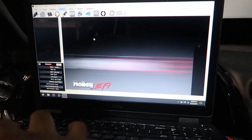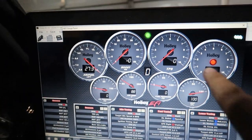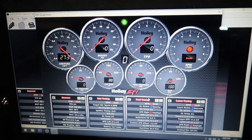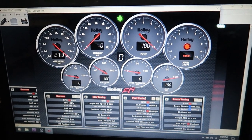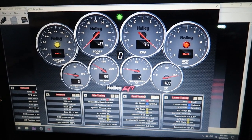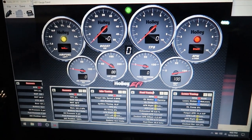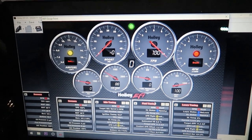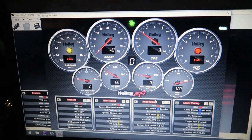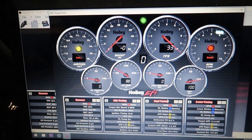We're going to do a quick TPS auto set. I've set one of the live gauges here to TPS — showing 100 and 0, hitting 99. I'm not really pushing it super hard; you can hear the CO2 solenoid noise activating. If this was race competition I'd be right about there — that's 100. I think we're good. Try a slow increase.